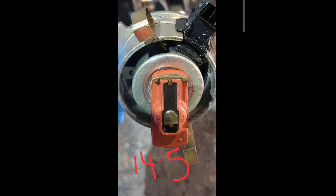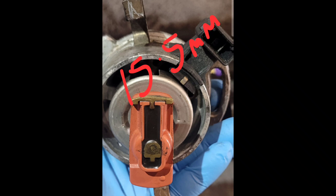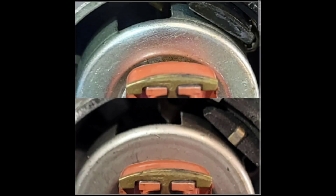Measuring the trigger windows: one of them is 14.5mm, three of them measure 13mm. These are all meant to be exactly even points for spark — and they're all wrong. On the stock 16 valve one, all four trigger windows are exactly 15.5 millimeters. I've checked that on another 16 valve unit I have and it's exactly the same.